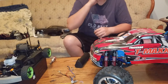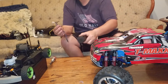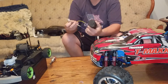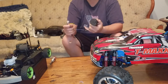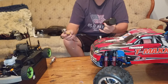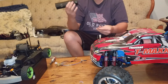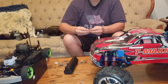To start your engine you need a type of electricity, which would be a glow plug igniter — in this case Traxxas's wand. My dog got a hold of it but it's a perfect thing to show. It has three wires: the yellow grounds out to the block of the motor, the blue wire has a spring on the end that connects to the glow plug, and you press a little button while the motor is spinning to ignite the glow plug.